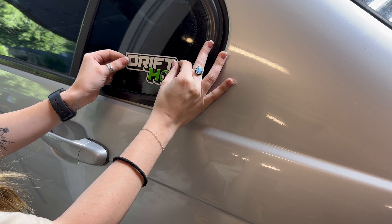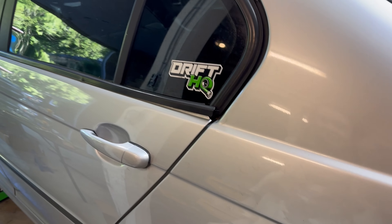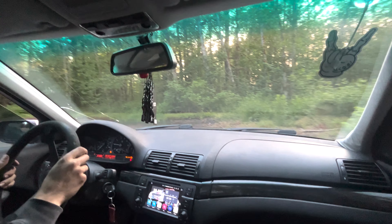I've been trying to get this done really fast, but a little update: the subframe went in fairly easy, but we had three people so that helped a lot. You can see here are the reinforcement plates — I painted over them — and here are the bushings. The bushings were a pain. I just put them in the freezer and that helped a little to hit them in. Got some new brakes and rotors on just because I had it off already. One thing to note: e-brake cables run through the chassis right here. I made the mistake of not putting them through the chassis before putting the subframe up, and I had to drop the subframe again to get the e-brake cables back in. So make sure you get these cables in before. One runs on one side of the driveshaft and the other runs on the other side, and then they go through here and up into the car.